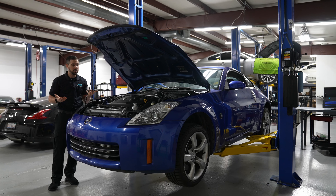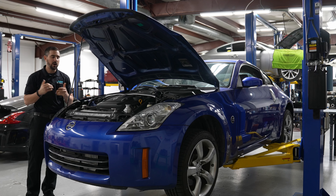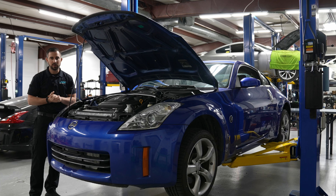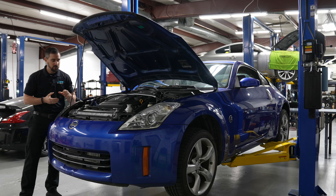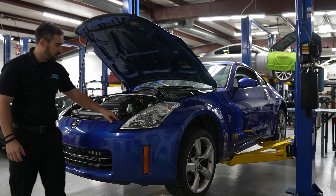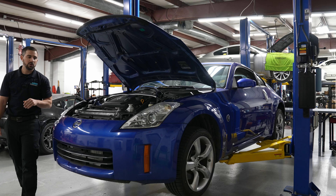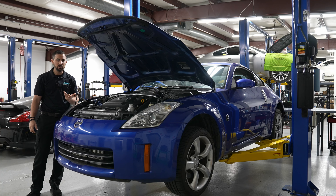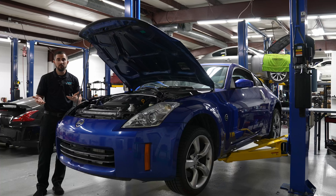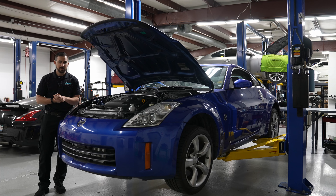So you could make a lot of horsepower on this car as long as the motor and transmission can handle it. A 7-pound spring comes automatically with every single kit, but you can do a 5-pound spring or whatever orientation you'd like with the spring setup. The charge pipe comes down, goes around, goes into the intercooler, and comes out the top side of the intercooler into the throttle body. We're using one of our Garrett cores that we've been using on our VHR single turbo kits and also our V2 air-to-air supercharger kits — same intercooler core and tank configuration, so we know it works.